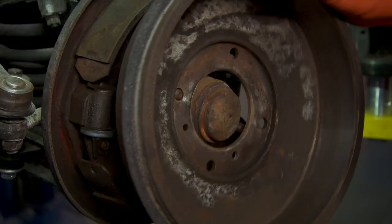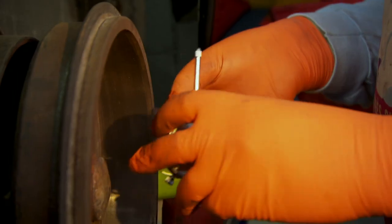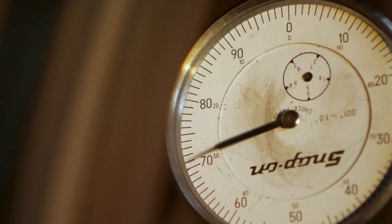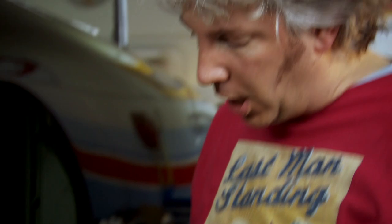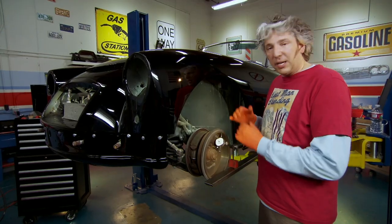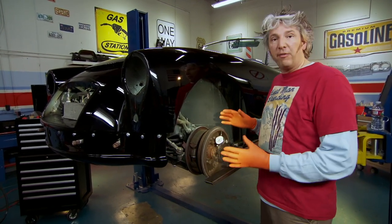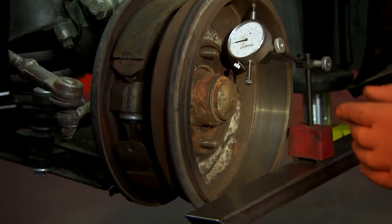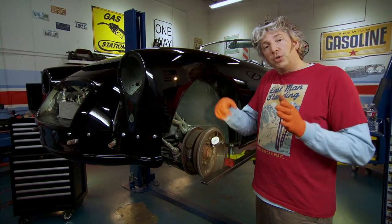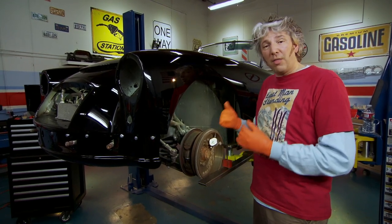I bolt the drum back on, but backwards. Then I line up a DTI or dial gauge, which can measure surface variations. You can see straight away we've got loads of run-out here, so effectively this drum is oval in shape. The reason that can happen is maybe if it's a warm drum, you've been using your brakes a lot, and you go through a cold puddle — it cools down the drum really quickly and that can help distort it. If you've got it on this side, you may well have it on the other side, and as you go around corners, your wheels are going to effectively speed up and slow down at different amounts, so it's going to come in and out of phase. It could get really rather unpleasant.